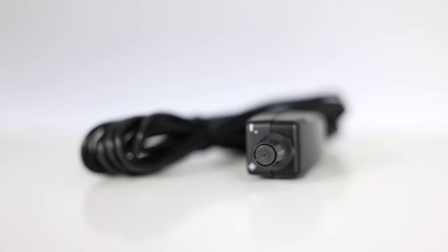Okay, so a huge difference in the way it sounds. Now there is an attenuation knob that's mounted up front that actually comes with this box. And when I turn it down all the way, it's a huge difference between obviously just the speakers and then with the subwoofer. So that subwoofer does give it that nice oomph that you need, because obviously a 6.5-inch speaker is not going to produce, you know, a 40, 45 hertz bass note like a subwoofer does, even if it is an 8-inch.